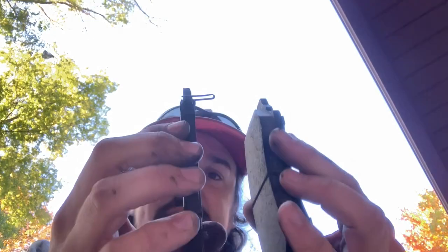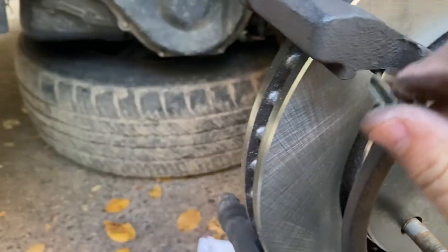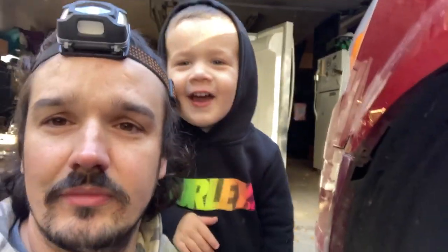Now we're going to chuck these brake pads. Here's the differences in the pads — I think I had a little bit left. It came with these things, so I think we should probably put these things in. I think I'm going to go in like this. There you go. Now we've got to put the caliper on. Use a razor blade, cut that. Now we've got to push this piston — right by my left index finger — inward. This is where you're going to use a C-clamp to push against that piston. I'm going to use one of the old brake pads to push up against it. Now it's compressed back into itself. Put the new pads on.